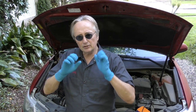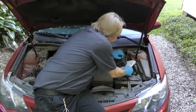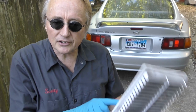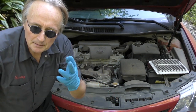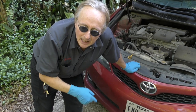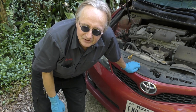If you live in California where they actually measure the tailpipe emissions, you need to do a little more preparation. A dirty air filter can make you fail — if yours is dirty, change it before you have the test done. The same goes for oil: really dirty oil can make the car pollute more and might cause it to fail the test. So if you live in an area where they're actually measuring the gas coming out of the tailpipe, change your oil and filter before you take it in for testing.